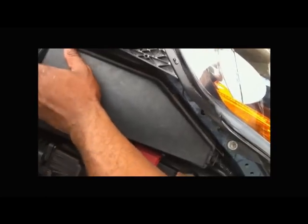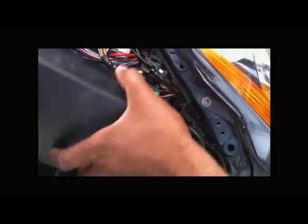Okay, I've completed the soldering for the wiring that I brought from the salvage yard. As you can see, I've placed the 2 wires that I bought, and they're right here. I've soldered them into the wiring harness, and they clipped right into place into the new fitting. And I opened up the box and ran the wires straight into the fuse box. This little piece right here, you can just pop it out. This piece pops right out, and you can run it right into the box.